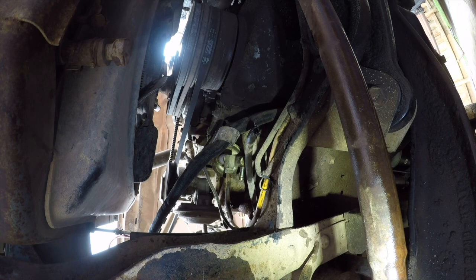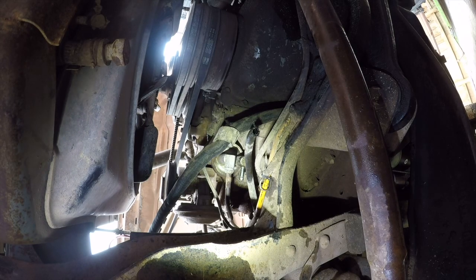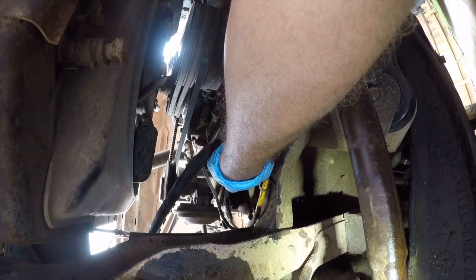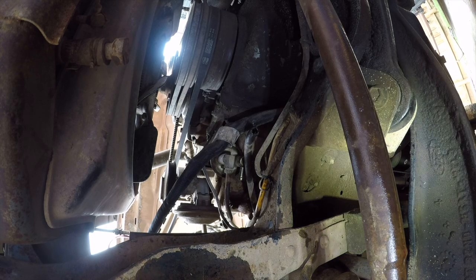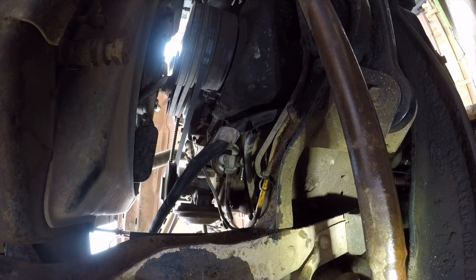There's no point in hooking another source of fuel up to this at this point, because it doesn't pump. Let's go ahead and pull this — well, I'll save pulling this piece of crap out for when I have the replacement pump. So that's it for today. We have a dead fuel pump, because we can put our finger on this and we get no lift. Was it installed incorrectly, or is it just bad? Let's just go with it's bad for the moment, and we're going to say a lot of bad words when we replace it because it's really difficult to get to. So that's it for diagnosing a fuel pump, and that's all I can do for today. Thanks for watching this episode — I hope this is helpful for people that have a similar problem with their IDI diesel.